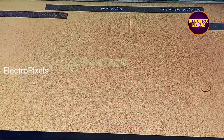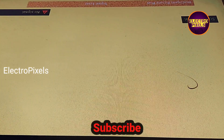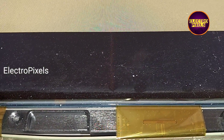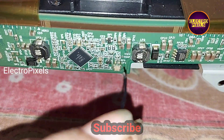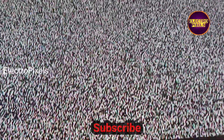Now let's turn on the TV. We can see the complaint. Now let's connect the jumper wire to the VGH P test point. Here you can see — while connecting the VGH voltage, the panel complaint is solved.